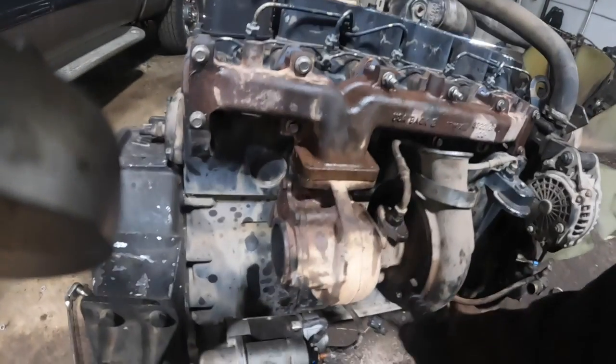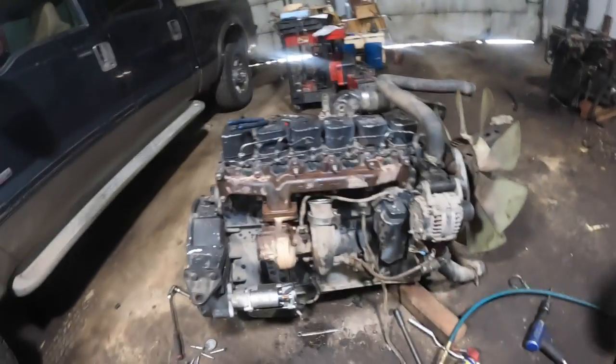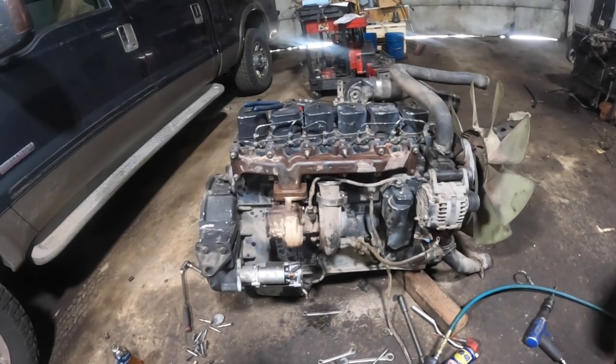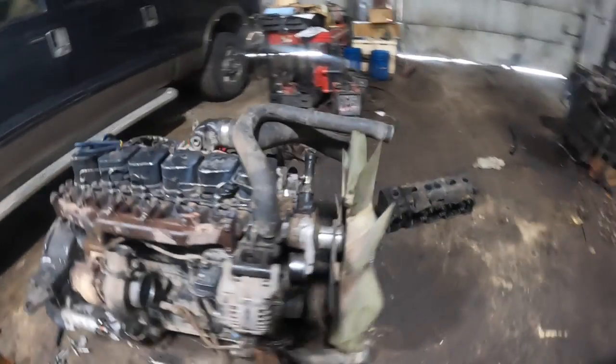See, this turbo has been a little wet around the impeller housing. I don't like that, so I called and ordered another turbo. I don't want to sit there and be down with the turbo that's gone out, so we're gonna go ahead and put this one on, but I can change that in the truck. That's not that big of a deal.